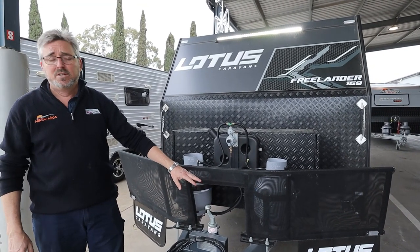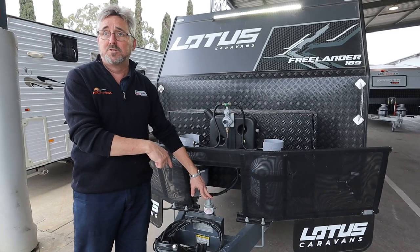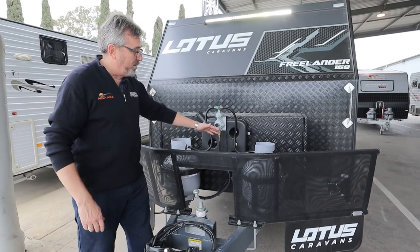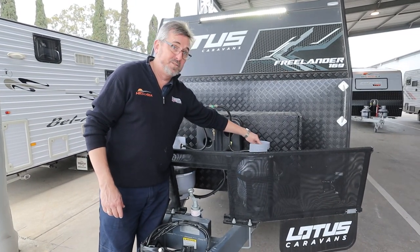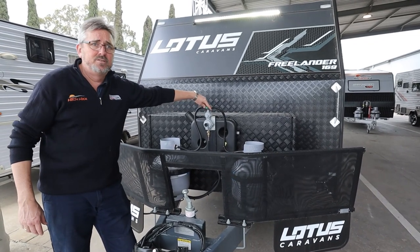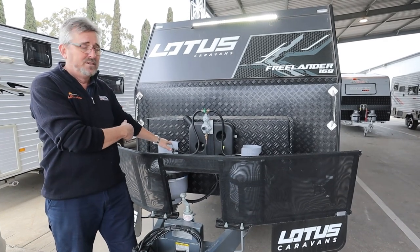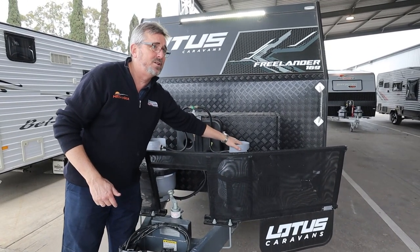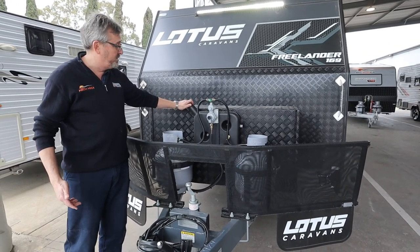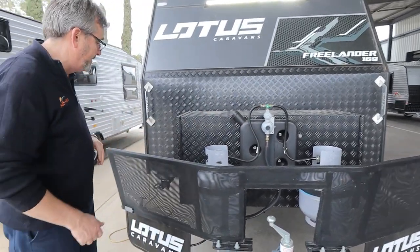Jockey wheel - take it off the travel. Make sure when you get this off the truck that your jockey wheel's there somewhere, because the truck driver normally stashes it somewhere so it doesn't disappear. Your gas bottles - they're both full, I filled them up just a little while ago. I'm using that one, so I've got the lever that way. Don't do that, because you'll get out the car one day and open this one, then get out the car the next day and open that one. Leave it on the one that you're using because it's open. Your diesel tank for your diesel heater - top it up with nice fresh diesel. There won't be a great deal in there, but it'll have something in it.